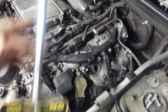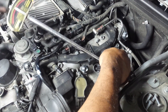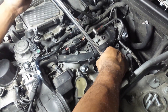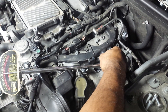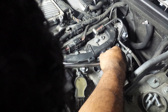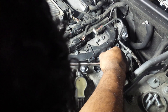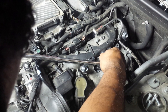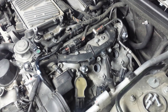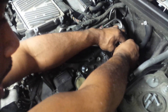I know some of you guys are going to ask, so I'm going to use a torque wrench. I'm using a vintage torque wrench but I'm going to torque this down to eight to ten pounds — no more than that. Cylinder six: put it in by hand. Make sure you don't cross-thread anything. Tighten it all the way up until it's hand tight. Make sure everything feels smooth.